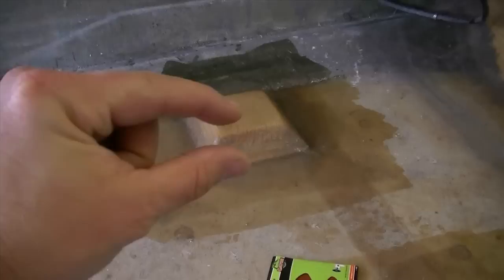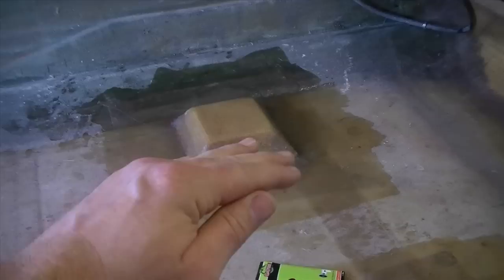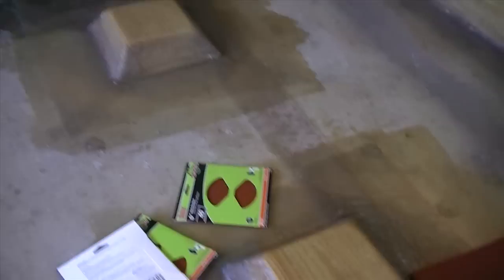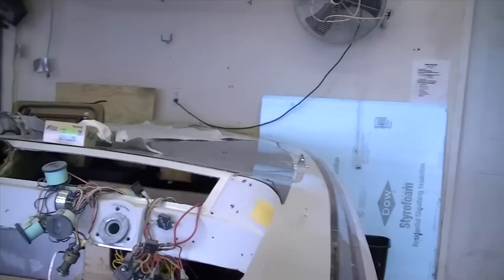And then they make a little swivel from Atwood that's locking, so that way you can swivel your seats. I'm not going to put those in because I'm not sure the new owner would like that. So we're going to put a piece of plywood in between that is loose, not attached to it, that would represent the actual seat swivel, and it'll be screwed through in the exact same four bolt configuration. That way, if the new owner wants to take it off and add a swivel, he can. I don't think it's necessary, so I'm going to go with the stationary mounts. These, I do believe, are almost 4 inches tall, maybe a little less than that, giving an overall height of about 4 to 4.5 inches when it's all said and done. And that's what I felt most comfortable looking over the windshield when I was sitting in the seats.